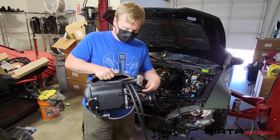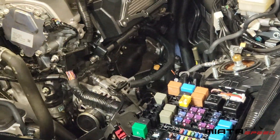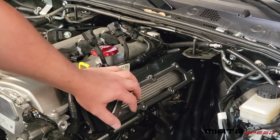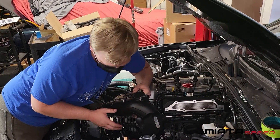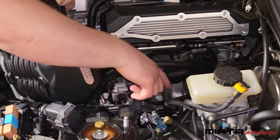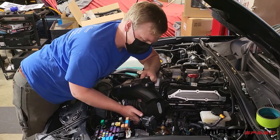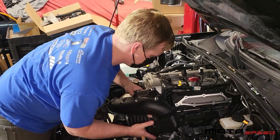Other than that, you just want to be aware of where your hoses are, and make sure you hook up your crankcase breather — forgetting that is also not fun. Don't forget your gasket goes right in between there. It's made out of metal, and you can give it a little bend so that it stays on nicely and you don't have to worry about it falling off. One thing to be aware of when inserting it: as well as being careful of the nipple on the bottom, this hose can scratch up your supercharger. They used to send them with plastic covering on here — I like to leave that on if it has it. Recently they haven't been. It's not a bad idea to cover it up if you can, but it's not necessary if you're careful.